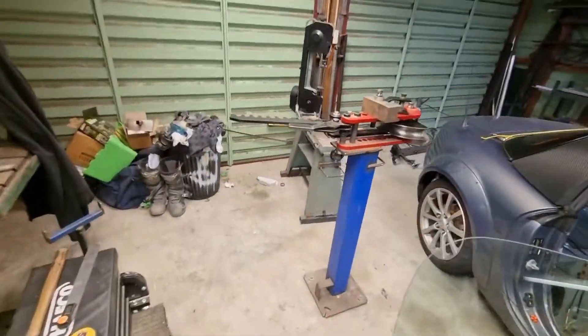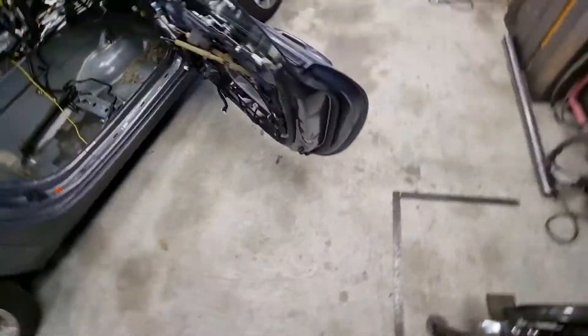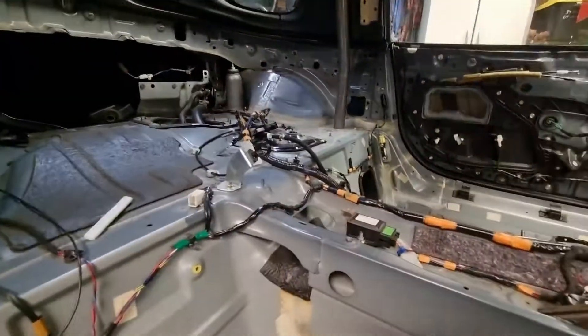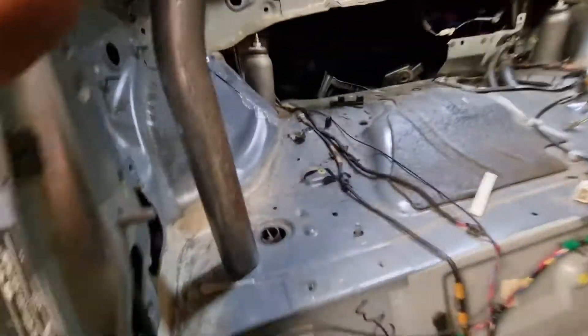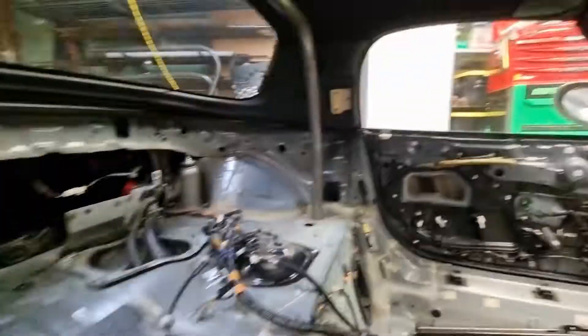We've just bent all that up. Took lots of measurements as we went — I made a little diagram on the floor here, basically just sketched out the inside to make sure everything was perfect. We have a nice tight-fitting bar. I'll just cut it down to get it to fit. There are reinforcing plates that need to be put in on the top here, which will lift it a little bit. I don't want it quite touching the roof, but I'm happy with that — we've got about 10mm all around, so that should be perfect. Get the reinforcing plates in, get that tacked in, and then we'll start looking at the front laterals.